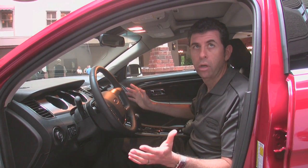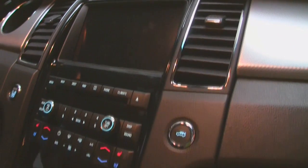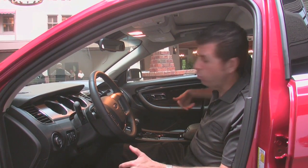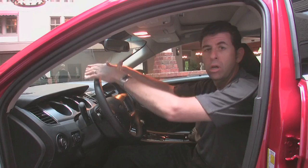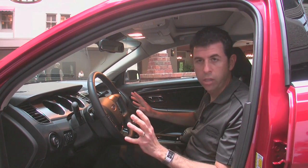One of the things we do in here that's really unique is we lay back the center stack at a 38-degree angle, which is further than we've laid back anything before, and that gives us the opportunity to create a very graceful, undulating S-curve that runs from the console all the way up into the instrument panel, and then it even appears to lunge forward into the hood. In addition, the console is higher, and it creates a cockpit-like feeling inside the interior and a very sporting personality.